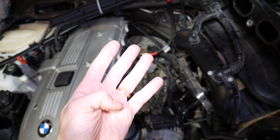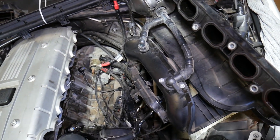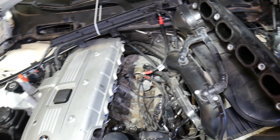Another symptom is rough idle. Number two is increased oil consumption — really high oil consumption — and that will lead to failing spark plugs, so you may also get misfiring codes. Sometimes you may even get codes P0171 and P0174, but this is mostly if you have a cracked hose or pipe somewhere on the CCV system. Those are the most common symptoms of a bad CCV valve.